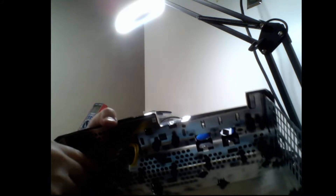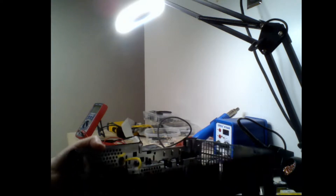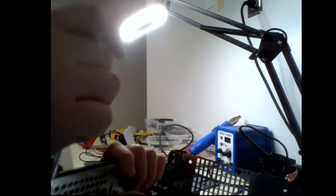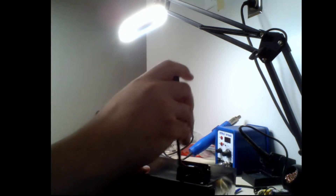So you've got three tabs in here — a plastic tab here, plastic tab here, plastic tab here. You might think that all you need to do is lift these tabs and you're home free. Wrong. So let's start with the side here. You'll notice on the side there's this little bevel right here, and it almost looks like it's angled for a screwdriver. What I see in videos is guys going down like this and ripping it. Do not do that. You do not want to go up and down inside the thing. You want to go sideways, right in the center of this thing.